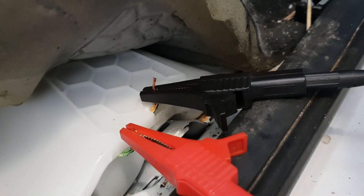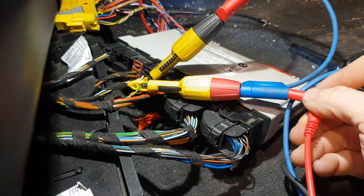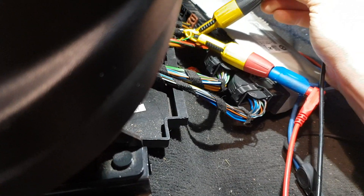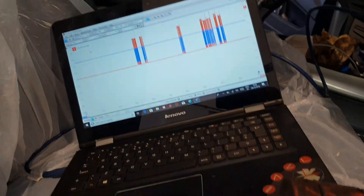So we're connected to those wires. We have our jumper leads just here. The red goes to the green, and the white to the other one. Under here, the red is that one there which is the green, so we're going to plug that one in there. Then what we're going to do is plug the other one into the other one — so it has its CAN high and its CAN low. Now we're plugged in the back of this, we should have a decent CAN signal and it should actually be operating.